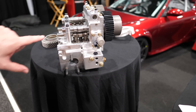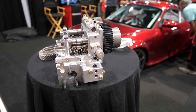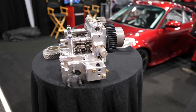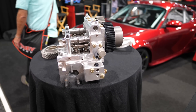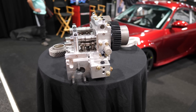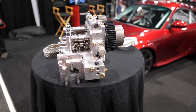I don't know if the stock rockers will work, because this is all K20 and we wanted to use OEM materials, so it would be easier for everyone to buy parts. I only wanted to make the heads, so we use Honda rockers. The valves are from a special Subaru engine — we didn't specifically want to use Subaru, but we went through the catalog to search for a valve that fitted this design and it turned out to be a Subaru valve. You can also buy valves from Supertech or Ferrea just out of the catalog.